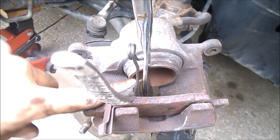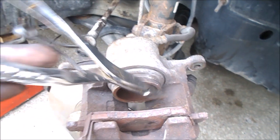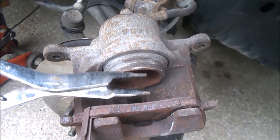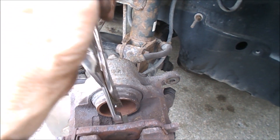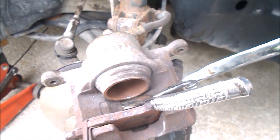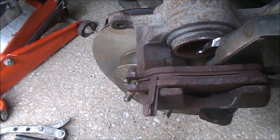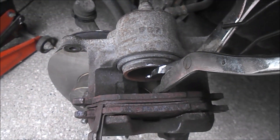One of the problems you're going to face is getting this piston pushed back. As the pads wear, the piston comes out, and you've got to get that piston pushed back to drop over the new pads. I use a circlip spreader to narrow the space down. But this one has been particularly resistant today, so not only have I been using circlip spreaders and my hand grip, I've literally been placing my channel locks over the top. Without those channel locks on there, this would not be moving. Get some good leverage and just pinch it — you can see it moving. Once I got it started, it seemed to be a lot easier. That's the process: circlip spreader.